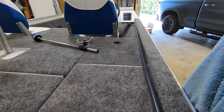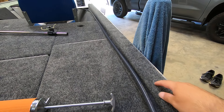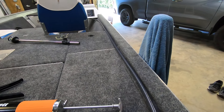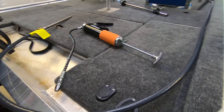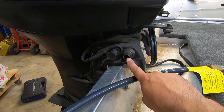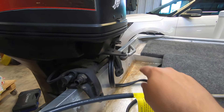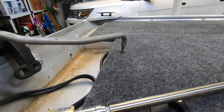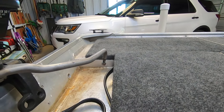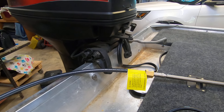All right, so here is our steering cable coming back from the console — it's going to be underneath this panel once it's installed for good. This panel is not anchored yet so I can just cover it up, but I want to make sure I get a good line back here and a good fit before I do anything permanent. So what we're going to do next is take our marine grease and grease up this channel where the steering rod goes in. It's going to come out the other side and then attach to this steering arm. We'll grease up the whole thing with marine grease and then we should be able to get some turning on the motor.